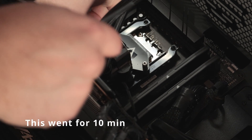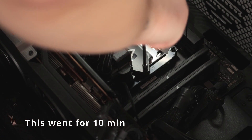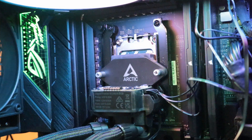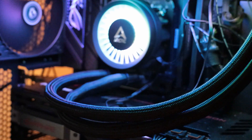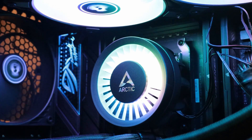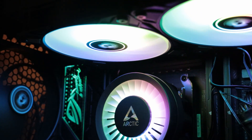With the GPU installed it's quite hard — you really need to find the perfect balance in order to screw it in. Look how much of the pump is beneath these two screws. Not an easy task for the uninitiated. Once you manage to finish the installation, depending on the case the tubes may stick out, so you'll need to do some angle adjustments on the pump side. Once you're done you'll be greeted by a nice looking AIO.